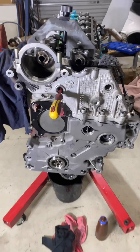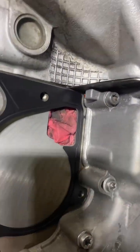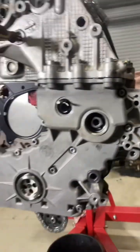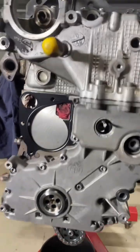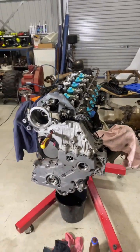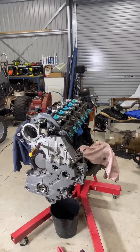Timing chain cover is back in place and all torqued up to spec. We've got a little bit of sealer in each corner and around there just so we don't run into any leaks. If you guys want to see more on this, definitely stay tuned — I'll do the next video on timing up the cams to the bottom end of this M57 diesel swap into a 105 series Land Cruiser.